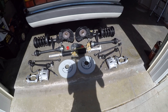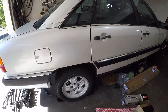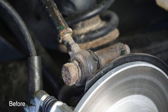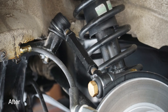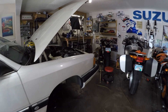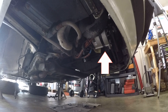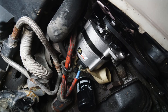So that's everything that needs to be done on this car — everything just needs to be put back in. Now there are a couple of jobs I've already gone ahead and done. One is related to the rear suspension: I did install bump stops on the rear shocks as well as the bellows cover shield cups, and also installed new upper lateral links so the rear end is fresh and the ball joints back there are in good shape. Moving up to the front, I also replaced the alternator. A previous video tested the battery and charging capabilities and it turns out the alternator was in very poor condition, charging only about 13 volts when it needs to be closer to 14.